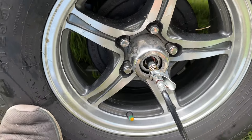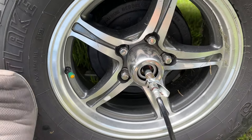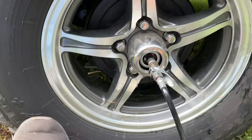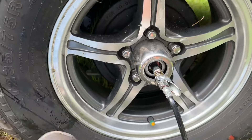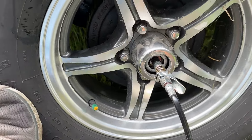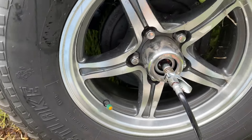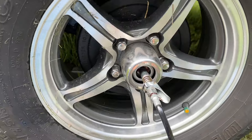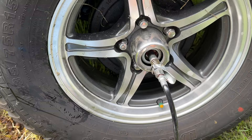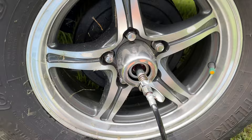You rotate the tire until you see the old grease start coming out the front. If you can hear that little scrubbing sound, that's just the brakes on the hub — that's just how they work. My initial trip with the camper was 5,200 miles, so this is due.